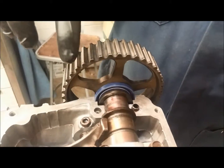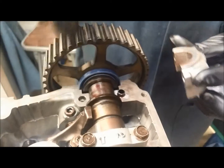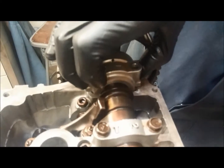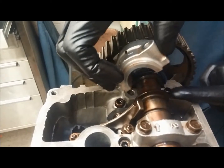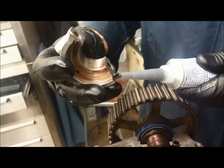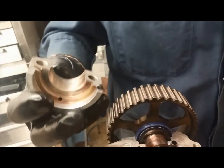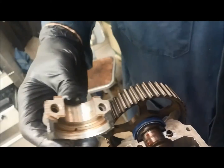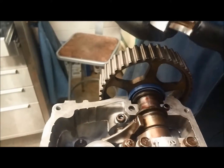Another place that you'll want to put some silicone — or watch for leaks — is on the end of this camshaft. We have this last bearing cap, and we put some assembly lube on the journal already. This cap sits over that seal, and of course that seal keeps the oil from leaking out, but there's nothing that will keep the oil from seeping between the cap and the cylinder head right here. So we should apply a little bit of silicone. The seal will sit right here, so just put a little bit of silicone right there so that it seals away from the camshaft seal.